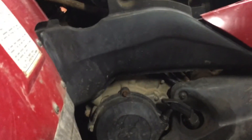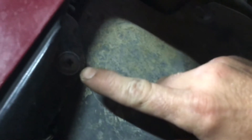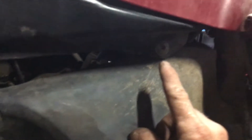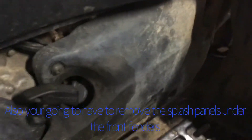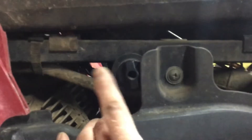To get this piece off right here, you got one right there — probably going to be underneath the fender right here. Underneath the fender, it's going to be dark under there. There's two more Phillips head screws underneath the fender, and that black plastic piece will come off. To get the tank off, you're going to have to be sure you turn your gas valve off before you undo the Phillips head screw that's inside there. That gets that piece out of your way, and before you go trying to remove it make sure you undo your gas line from your carburetor.